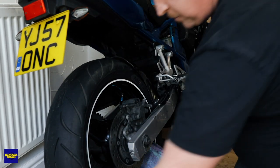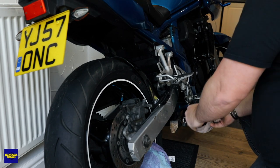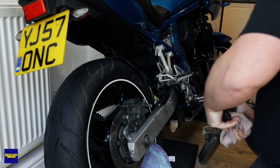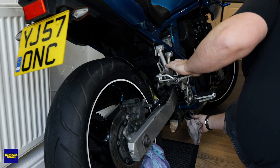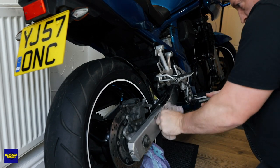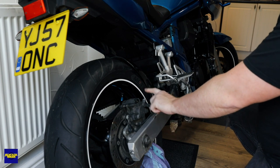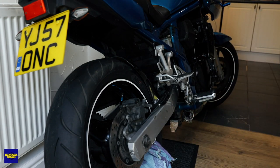It's off. Before I put it back on later I'll obviously give that a good clean inside. As you can see there's carbon on there, but this bottom pipe is going to need resealing as well, which hasn't been done for some time. It's a job I didn't think I'd need to do today, but as with anything when you're stripping your bike there's always something. When we undo this there's going to be some fluid — put it straight into the jug. That's why I've got this towel to catch the excess fluid, and then we can get on with taking the caliper off.